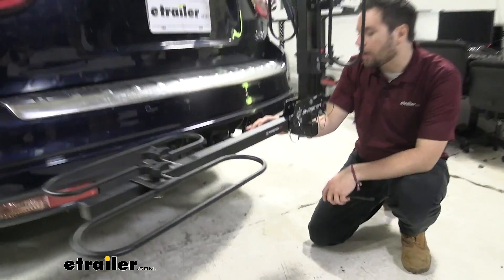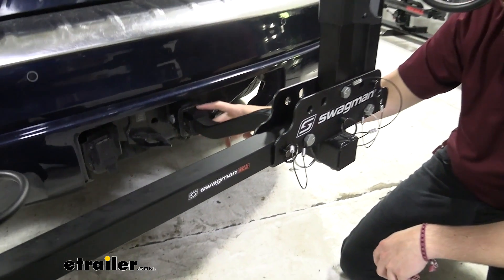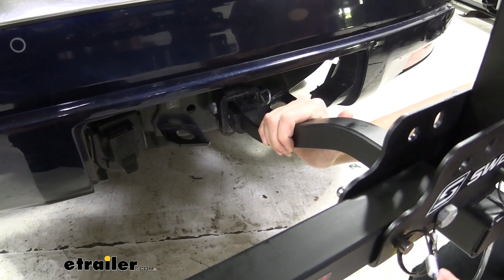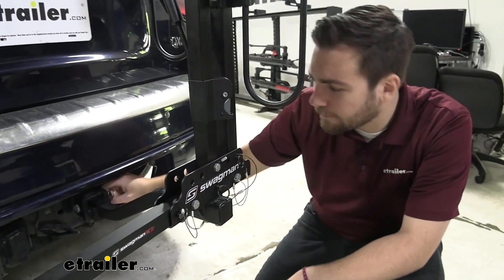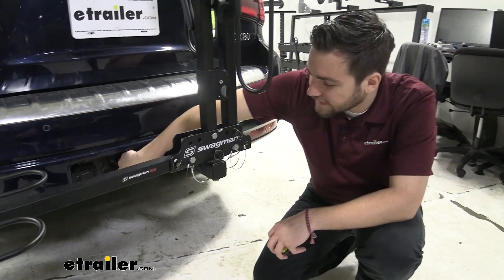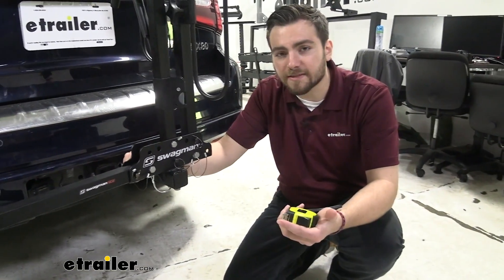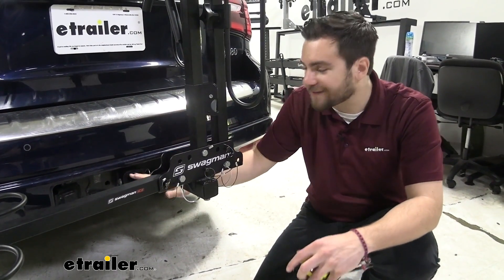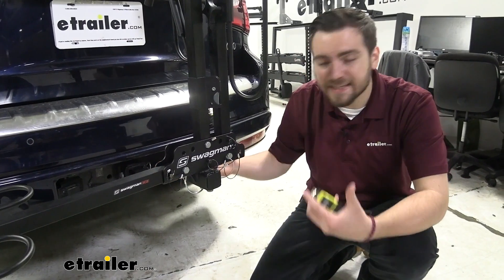Looking at our hitch receiver, we do have naturally an inch and a quarter receiver. However, we do have a two-inch sleeve adapter that's going to allow us to utilize our two-inch hitch. Being lightweight, this can be very versatile — if your family has a different hitch, an inch and a quarter hitch will also work just fine. At the back end, we just have a simple pin and clip system. This does have an anti-rattle threaded hitch bolt in it as well, so as I'm shaking this, it's going to get in line with our frame, making for a nice smooth ride for ourselves, our bike rack, and our bikes. However, as mentioned, no locking core — that's the disadvantage of this rack.